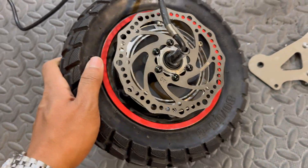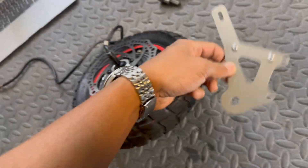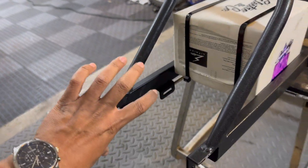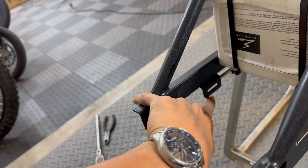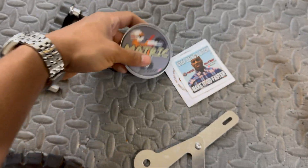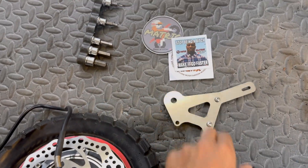We successfully flipped the tire on the rear wheel without popping the inner tube, and the 140-millimeter rotor is mounted. Now we're going to use the Mattrick Solutions adapter to mount a brake caliper on the back, since MX 350s usually come with a drum brake setup and there's no caliper bracket back there. We're mounting this between the axle and the mounting point at the bottom of the frame. I used the same exact bracket for my Pocket Mod project a couple of months ago — make sure you check out his page, Mattrick Solutions. I'll have a link to the listing in the description.